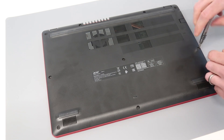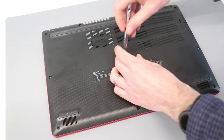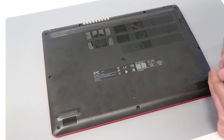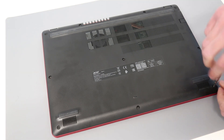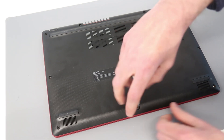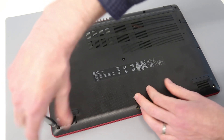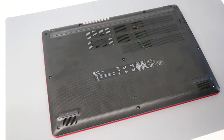This particular machine I have already cloned the drive using True Image to another SSD, taking out the one terabyte hard drive which it originally shipped with. Somewhat expectedly, the customer was complaining of poor performance, as you might expect from a relatively new machine with Windows 10 but running a mechanical hard drive. So with this done, we can now take our pry tool.